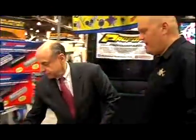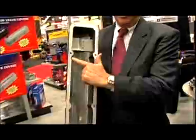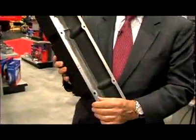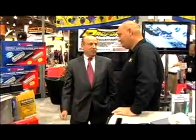I also noticed that they have clearance vertically. Yes, these are tall valve covers, and these are designed to accommodate almost every possible racing valve train. In fact, if you look very closely at this valve cover, you'll see that there's a little bit of machining that's taken place here and here, and this is to enable us to accomplish what we need for the last 5% of the valve covers that possibly could have a clearance problem. And then it's also an angled top, which is to help it fit under the hood. Oh, yes. The external clearance is very important, depending on the type of engine setup that somebody has.